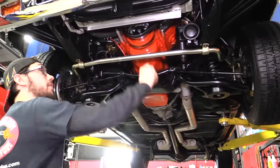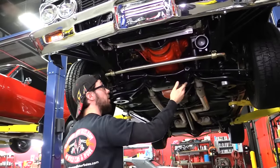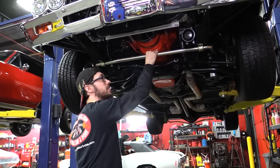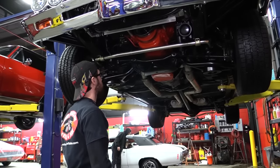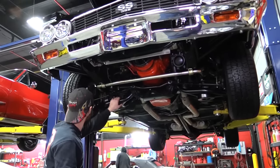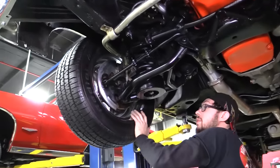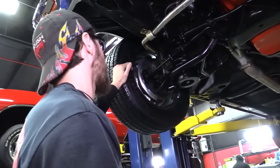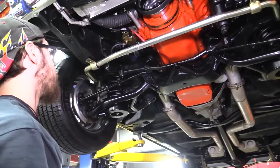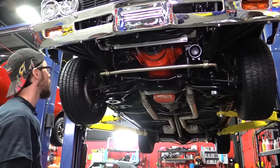This is the big block Chevy under the hood, and from the bottom side I can see we've got power steering, a big old front sway bar, and on the power steering I can see a whole lot of nice stainless lines. There was a lot of work that went into this car making sure it was updated. I've also got to point out the big monstrous tubular lower and upper control arms. Looks like Stainless Steel Brake Corporation as well, maybe — front discs nonetheless, very, very nice. Looks like all the ball joints and front end components were all replaced — give it a shake, it doesn't move, not nothing. Tires look like they're in great shape, which tells you the alignment's in good shape.